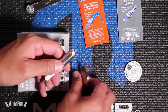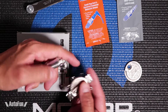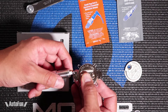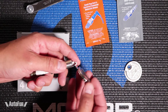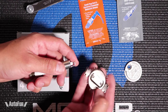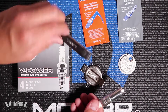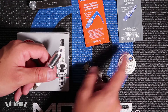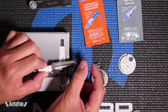This is where I find that the wire tool has a tremendous advantage, because the wire tool has a built-in little clip that you can use for adjustment. If I wanted to open up the gap I insert the tool in here and pull on it to open it, or push on it to close it, so I have full control — open and close — with this tool, where the dial one only allows me to open up the gap. The feeler gauges are just for measuring. But I like the wire one because I can control the gap.